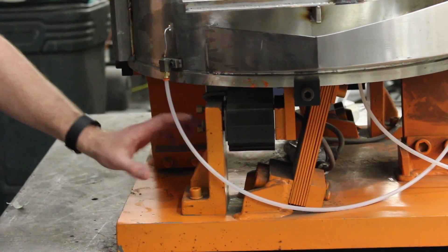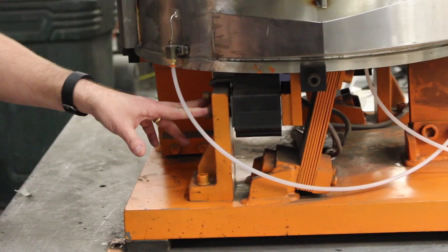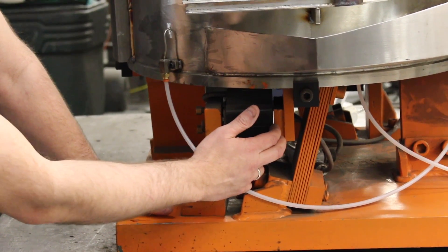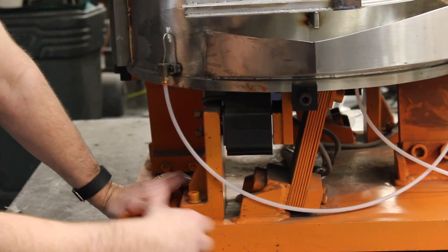Here on your coil, this particular unit is a little bit different. It has four bolts: two are adjustable for the coil gap, and two tighten the coil up. You want to try to get your coil gap as close as you possibly can. When that coil gap is as close as it can be, it's going to draw less amps and less heat, with more power.